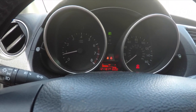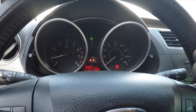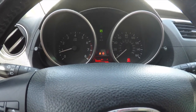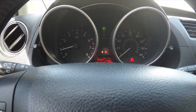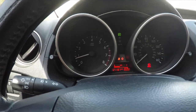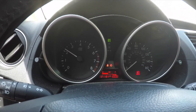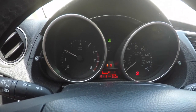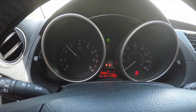Make sure you have coolant in the car in case the level drops while driving. I'm going to set a timer for five minutes and begin the procedure. Keep the throttle at 2,500 RPMs. Two minutes in — make sure the temperature indicator doesn't turn red, because red means overheating. Continue holding 2,500 RPMs.